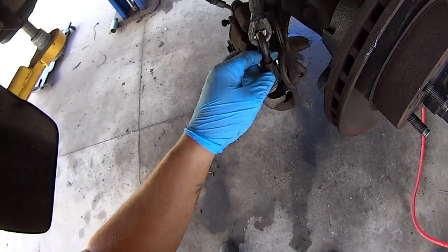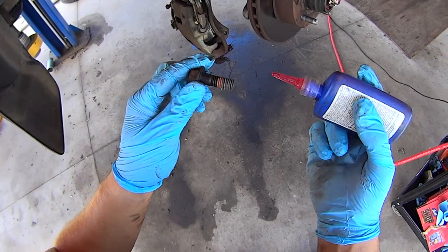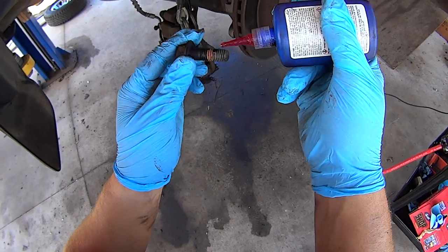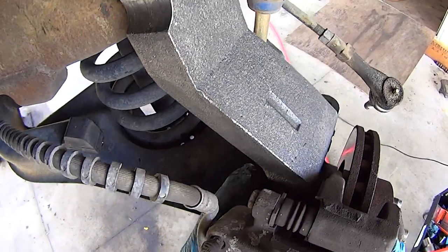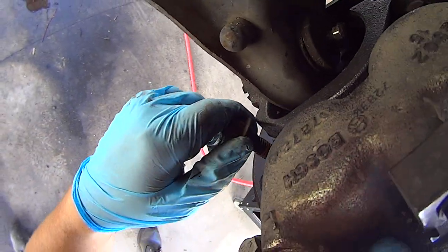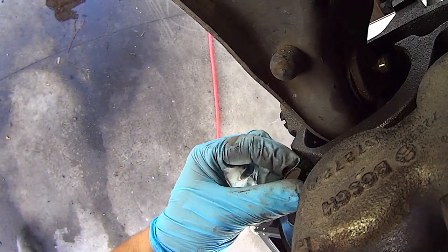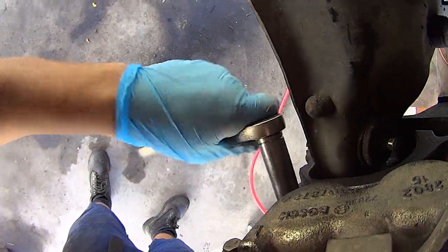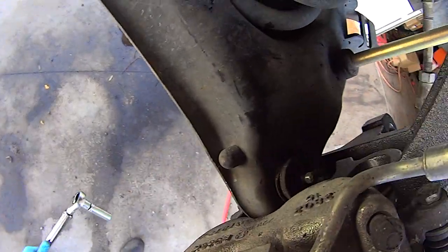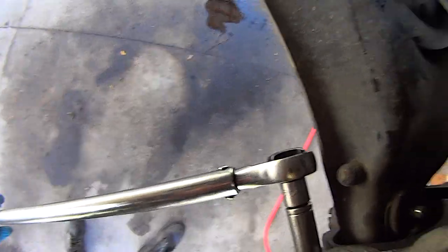Remove whatever you used to hang the brake caliper. Get the caliper bracket in place and use a tiny bit of red Loctite on the caliper bolt threads — don't go crazy with it or you'll never get it off. Start the upper bolt, then before you tighten it down get the lower bolt started. Tighten them down — the spec sheet says these bolts are torqued between 72 and 97 foot-pounds, so go on the high end of that.